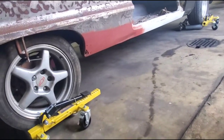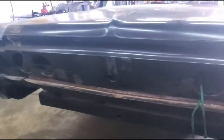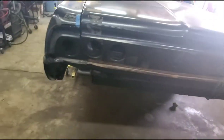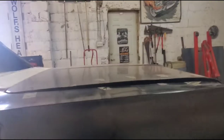Around the back of the car there's a rot hole at the bottom of the quarter panel that has to be addressed. Somebody did a patch there, so we'll strip that down and see what it looks like. They put a new deck lid on it, but nothing whatsoever is close to being lined up. They hung a new quarter panel on it but it's not welded in — you can see under the roof sail panel nothing's welded — so I have to do the final fit, clamp it, and weld that into place.